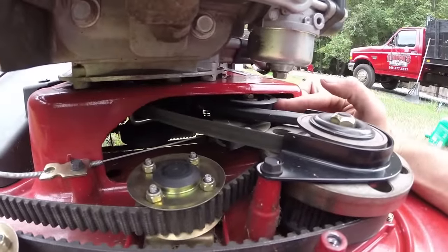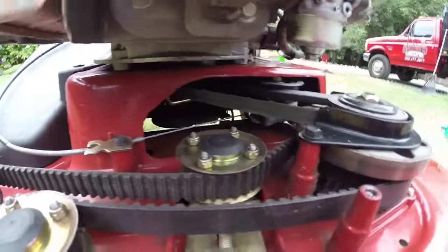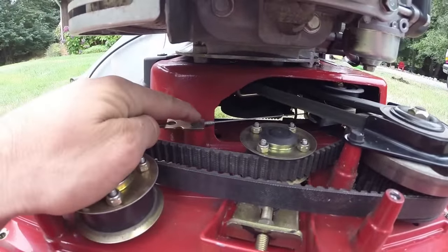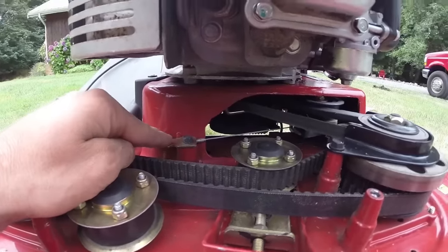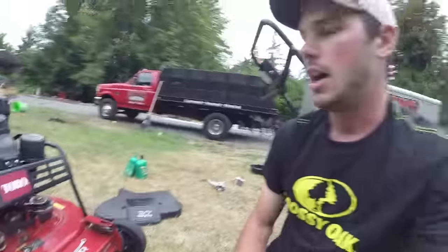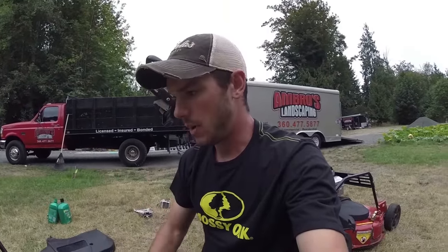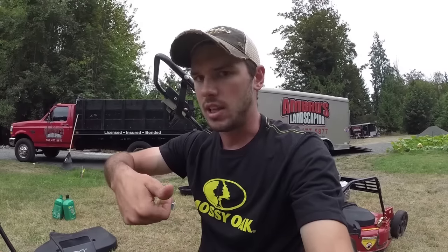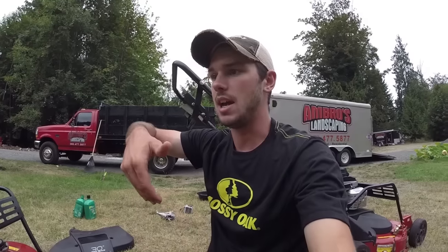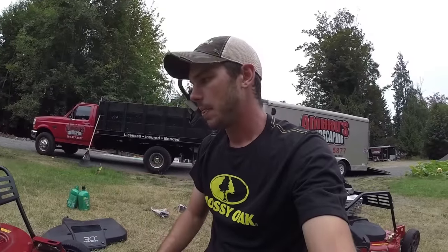this pulley right here, this is what the ticking is from, because this is your tension pulley. As you can see, it kind of goes in and out, and it's connected to the cable. So of course you can tighten this, loosen this bolt, and you go left or right, left to tighten it, right to loosen it. And you got to kind of work with that, because a few weeks ago when we were working on them, I had me and my buddy do it. What happens is that if you go too tight, when you go to engage the blade, slip it over and pull it up, there's a lot of tension on your hands. You barely pull down, and it's just not that comfortable on your hands. So you got to find that middle, because if it's too loose, it'll really rattle.